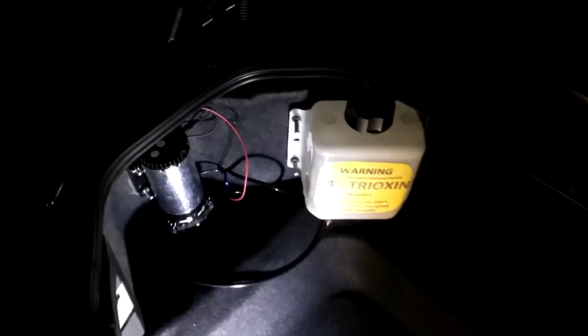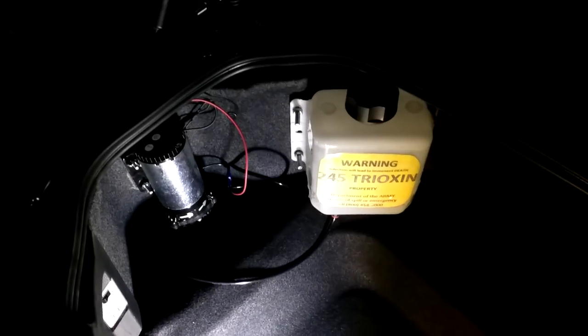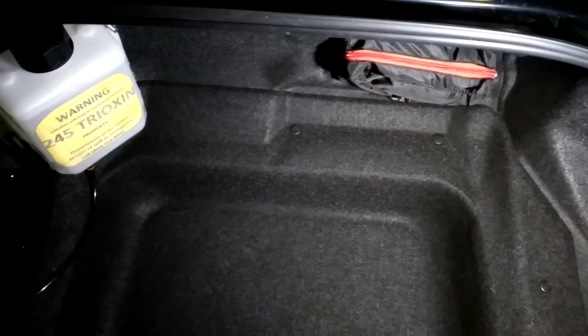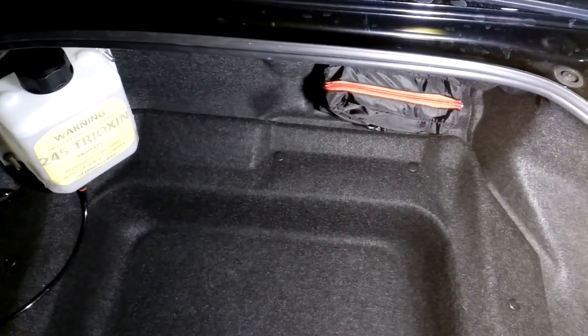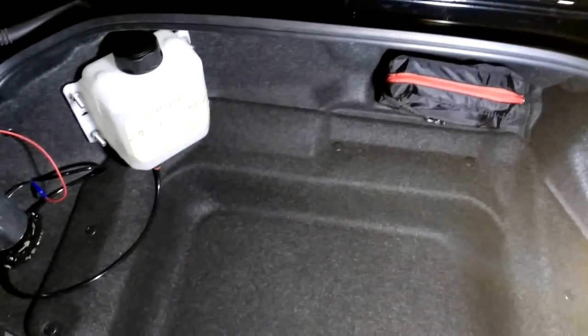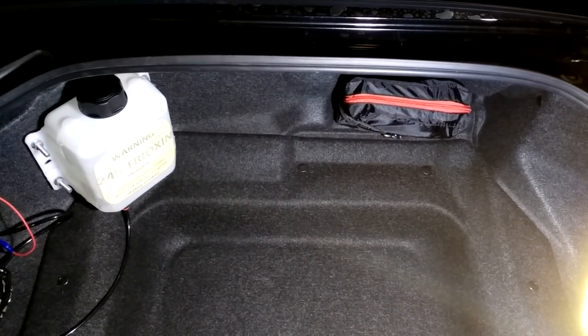I will start in the trunk. We've got a three-quarter gallon tank here and a pump. The reason I use the three-quarter gallon tank is simply because there's not a lot of trunk space. I like to take the car on road trips and I don't like to sacrifice too much trunk space. That tank is adequate for at least one, maybe one and a half tanks of gasoline and fairly spirited street driving.